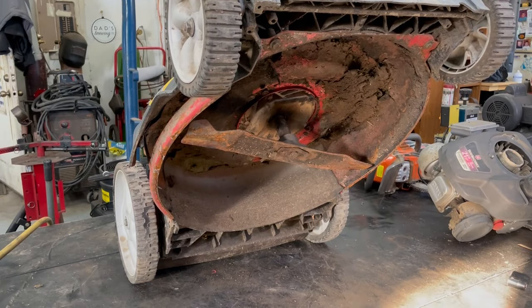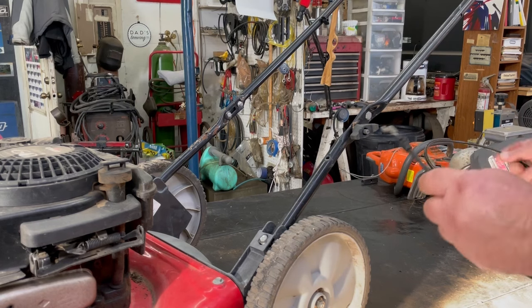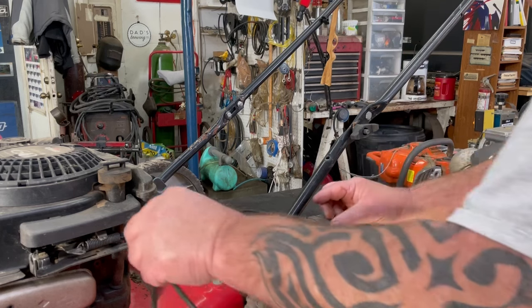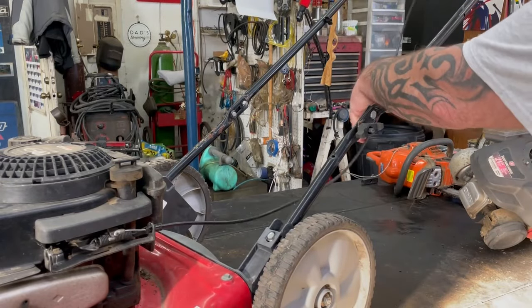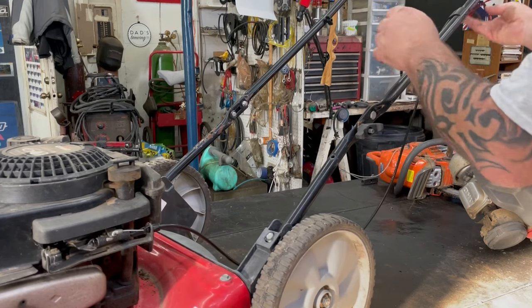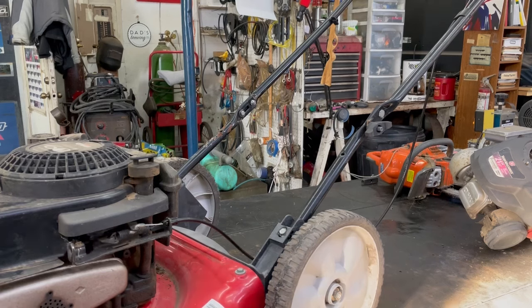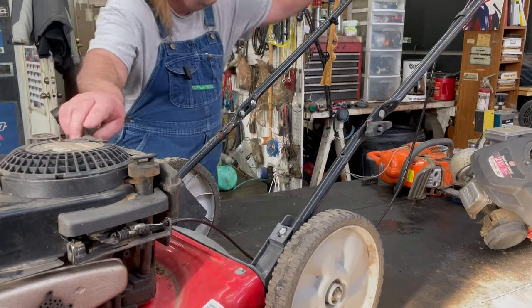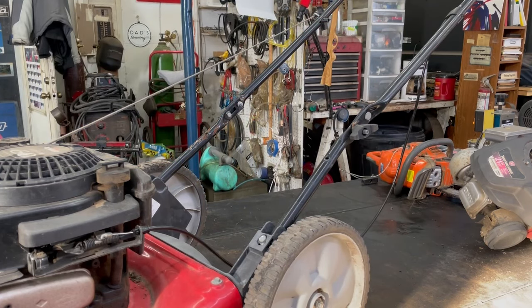Now we can lower it down and hook up the flywheel brake cable and put the pull rope bracket back on there and see if we can get this thing back to life again. I got a new flywheel brake cable - we'll put that on first because it's going to be hard pulling that rope unless that brake is released off the flywheel. Let's go ahead and pop her into place and make sure it's working good. On these motors, I have just hundreds of them that I've saved off of equipment - I always drain the gas out of them. You never know how long they'll be sitting on the shelf, so hopefully I just have to put gas in this thing and it'll start up. Now I can squeeze the brake cable and hook this rope back up. Now I can take it off the table and we'll put some fuel in there and see what happens.